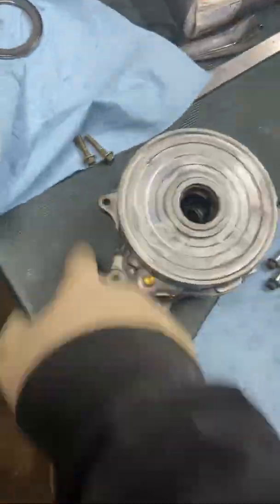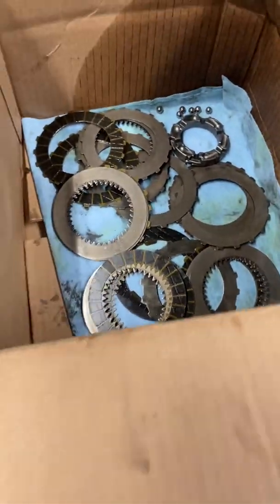After that, you pull off the pump. Here's the pump — it's got three screws: one, two, three. After you pull it out — I already did this, sorry I didn't get to record it — but you pull this little pin out of there, or sometimes it even falls out in the collar. You ditch those, throw them in the garbage. Same with all this — you won't use any of that.